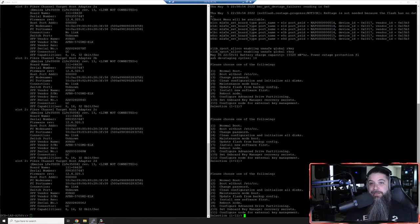Now that we're at the boot menu, this gives you options before ever booting ONTAP. It's almost like safe mode - if you're used to Windows or Linux, it's a way to make changes to the system without affecting the operating system directly. This is where you can scrub the system completely clean, wipe disks or factory reset the configuration of the entire array and any attached shelves. This is also where you can configure advanced drive partitioning - something we'll cover in a future video - to best take advantage of your very large SSDs.